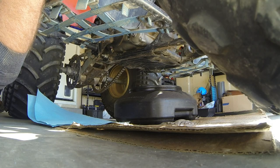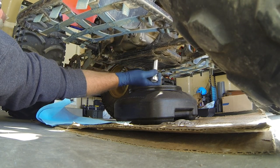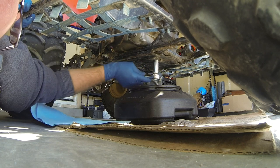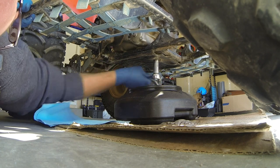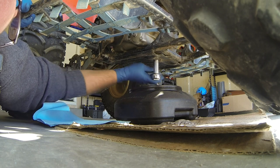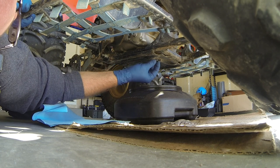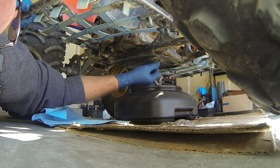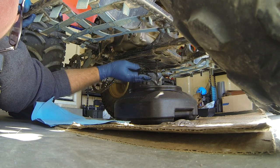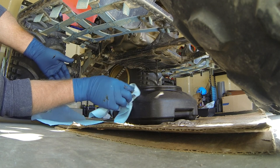Let's get started. I've had this for about a year and I have not changed the oil in it yet, but I haven't ridden it much either. I was told that if your bike won't go into neutral when it's warmed up, it could be just bad oil. And this oil looks pretty dark, so I'm going to assume that's the case and that it's not the clutch, because it doesn't slip. That's pretty sludgy, so we'll get this changed — maybe it'll start working like it's supposed to.